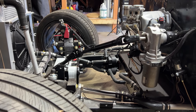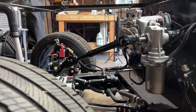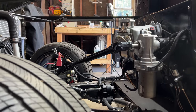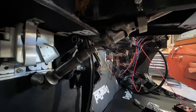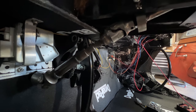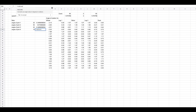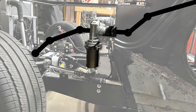I mentioned that the two front U-joints were phased to cancel out variation in angular velocity — that's not actually true. They have different angles and also different vectors; the input and output are not parallel. Both of the angles are sort of bending the same direction, but not exactly. The ones inside the car are also pretty dissimilar, but more parallel than the outside. I spent about two hours with a spreadsheet trying to calculate the output angles of each successive joint based on its relation to its input joint — all in an attempt to have the variations cancel as much as possible — but then I remembered that math is stupid and I don't care. So it is what it is. It's probably fine.